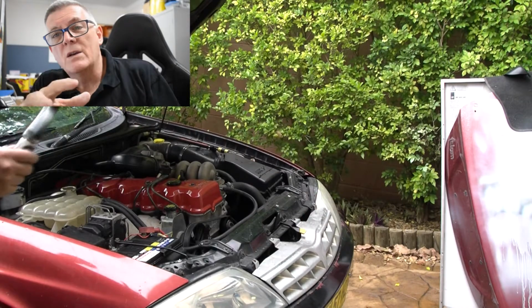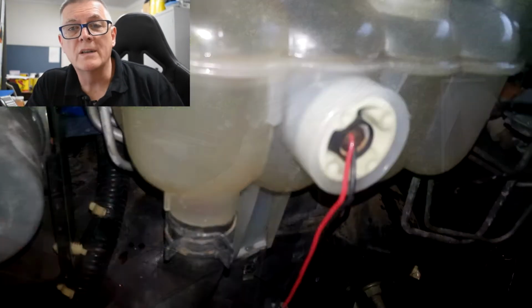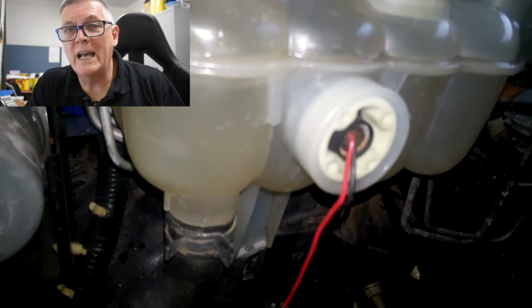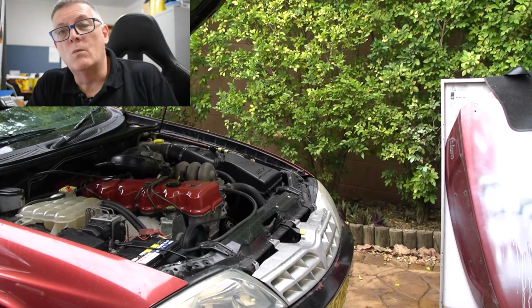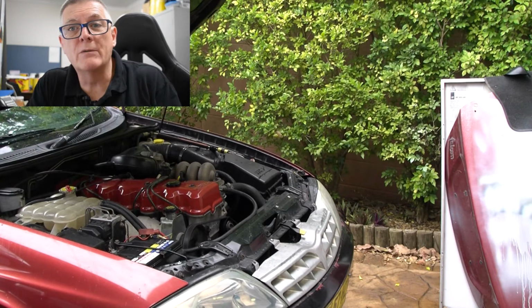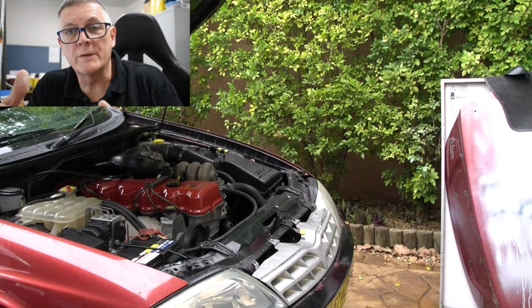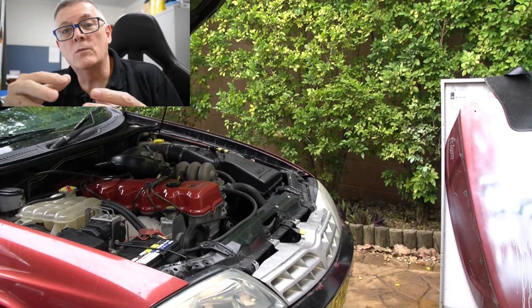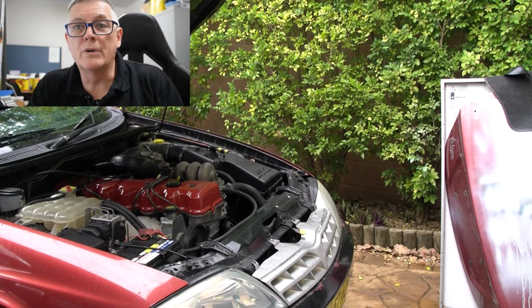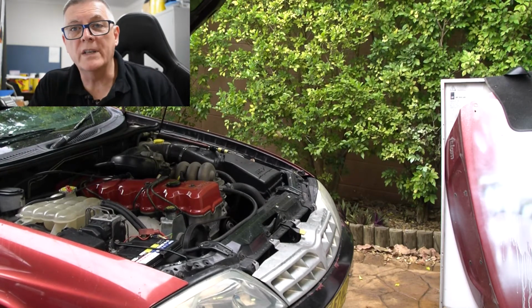Put the cap on. When you put the pre-solution into the bucket, or made up the pre-solution, it was clear. It was maybe a bit hazy, but it looks like clear water. Now, when you pour that in and then start running the vehicle, it has that big reaction. The part A will have a big reaction with that soft, furry stuff, the top layer of ferrous oxide. It will break it down very easily. And as it breaks it down quickly, it will make that clear liquid go like a big brown scungy pea soup in there. It's a real murky colour, a real reaction going there.